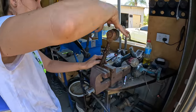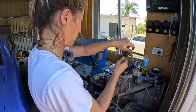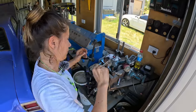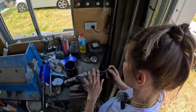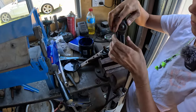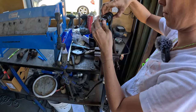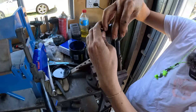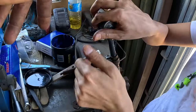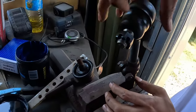Jesse has undone the tie rod end clamps and we're just going to remove these old crusty ball joints, nice and lubricated up with WD-40 to make it easy. We're whacking a little bit of bearing grease on the thread — anti-seize would probably work better but this will help it not seize up. WD-40 works too if you haven't got anything. Note that this one is a reverse thread because of how it goes in, and the other one is normal thread. Make sure you get the right one.